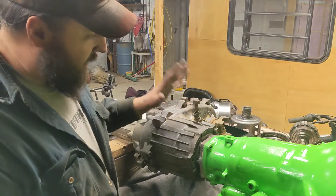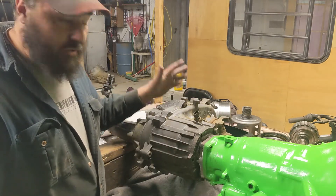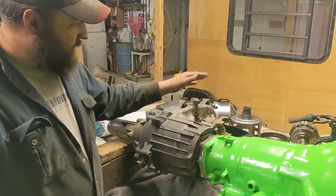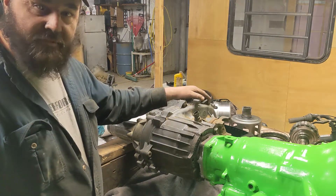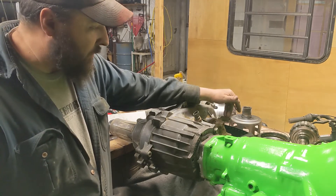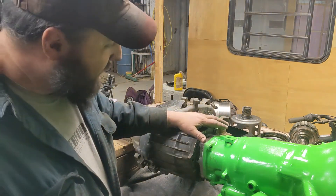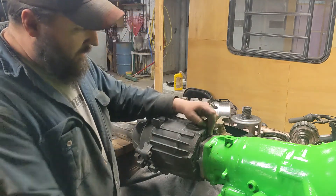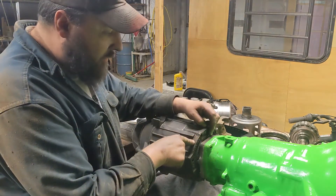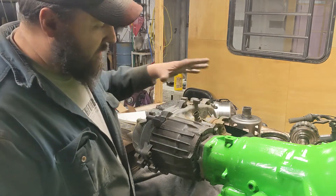No special fasteners required — it's the right thing to do. What are the negatives of clocking it up more? Now of course I'm going to have to cut the floor in the Jeep, which isn't a big deal — I've cut my Jeep up once or twice before. This part of the case is going to interfere with a cross member under the floor, and my drive shaft is actually going to hit the floor under my feet, so I'm going to have to modify that as well. But no big deal. I'm just super happy I can get all six bolts in finally. Once these two pieces are welded together, I'll be able to drill through from the transmission side back through the transfer case side of the adapter and counter bore those, so the whole adapter will bolt to the transmission first and then the transfer case will get bolted to it.